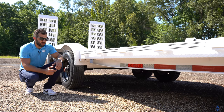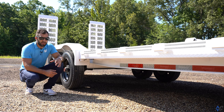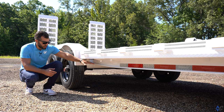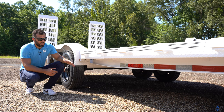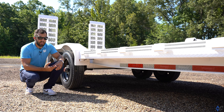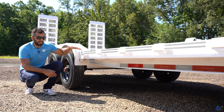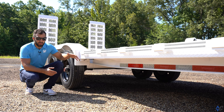The 210 package means this trailer is rated at 20,000 pounds GVWR — gross vehicle weight rating. When we graduate into these heavier packages, it includes our signature engineered beam frame technology. We control the height and thickness of each beam we produce, which dictates its strength, depending on the length and the gross weight rating it needs to have. We put the metal where it counts the most, rather than buying a regular mill spec beam and chopping it up to make it work.